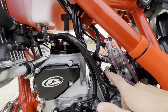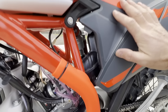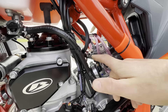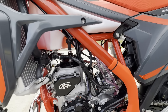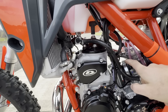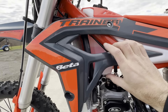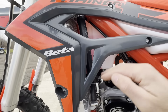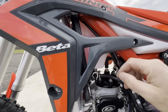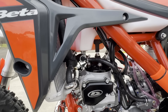Here's our carburetor, and it is oil injected. You can see the oil injection line coming up through — it goes into the bottom over here and then sneaks into the air box. This is our choke; we can turn it on and off. It is about 44 degrees out here this morning, so we will be using the choke. We have the gas on reserve because there's under a gallon of gas — if we ran it in the on position we'd run out since it's above the fuel petcock. Reserve is very tall in these tanks and has been for a very long time.